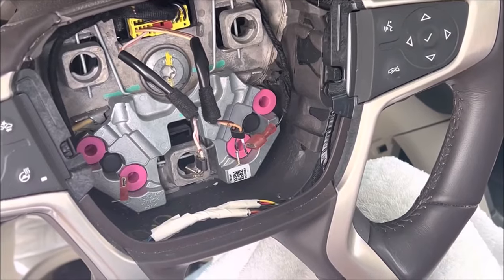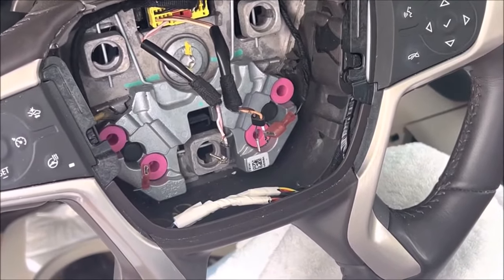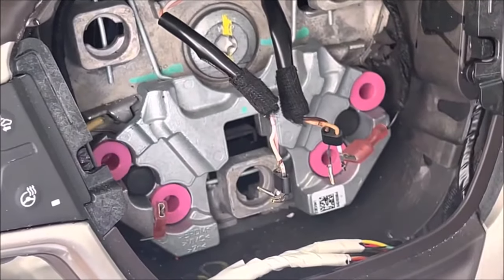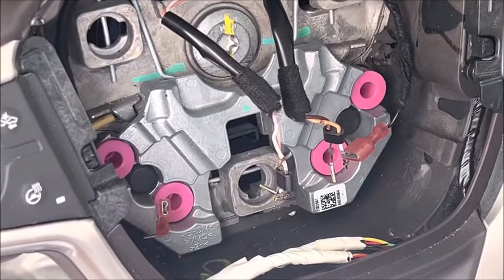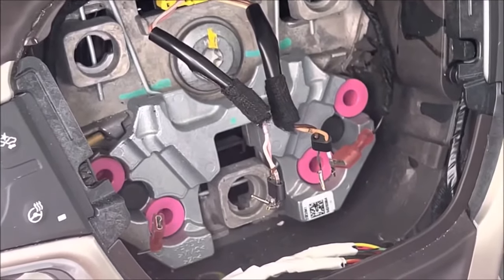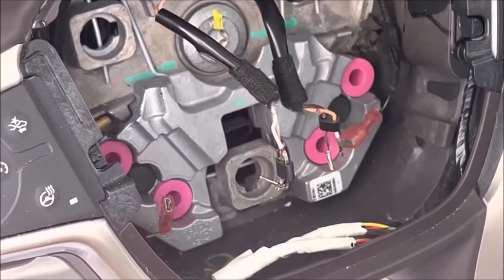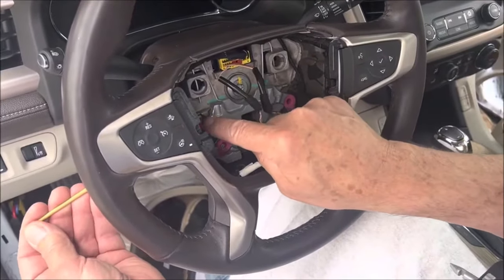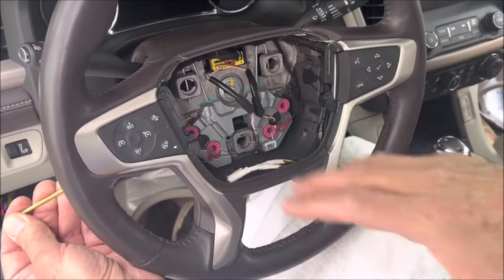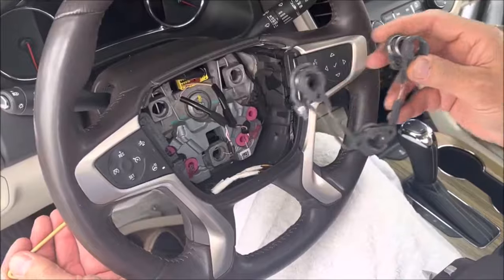They're correct. When you go in at eight o'clock on the left side, four o'clock on the right side — just keep a little pressure and push it through. Here's the main thing that will help you more than anything: the pressure on the screwdriver — and I won't use one in the future, I'm going to use this round spike rod — keep the pressure pulling towards you. That keeps this end of it against the aluminum plate inside the steering wheel. When you're working blind, the other videos don't tell you to do that. The main thing is keep the pressure the other way.